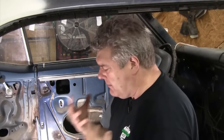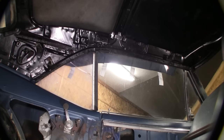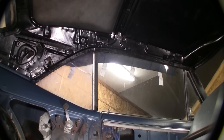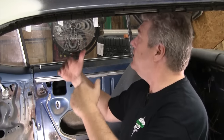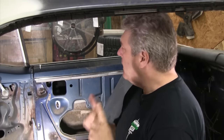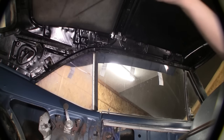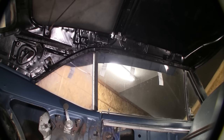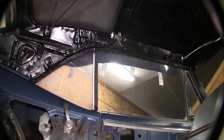So we've gone in and done a couple of things I probably wouldn't normally do. I'm going to go through and line out what you should do whenever you're putting a headliner in one of these cars. I've gone in and blacked everything inside this car. If your car is in better shape — headliner was in position, you pulled it down and everything looks copacetic and you aren't as rusty — some of what I showed you last week won't apply. Before you pull your bows out of the car, I'd recommend you mark for two things. You need to mark for bow position — each bow has a certain location in the car. I recommend only marking one side of the bows when putting them in the car. That way you know you've got the right bow in the right location on the right side.